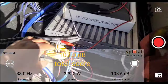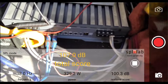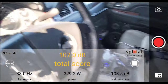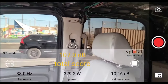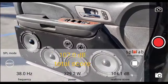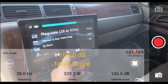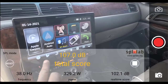I've got the clamp meter hooked up to the SPL Labs wireless bass meter, with the positive and negative leads on the cables here, using 10-gauge for the subwoofers. Right now every window and door will be sealed off, even the driver's side, but I'm going to leave the driver door open. Volume is going to be at 48 because that's where it's tuned to with zero distortion with the SMD DD1.